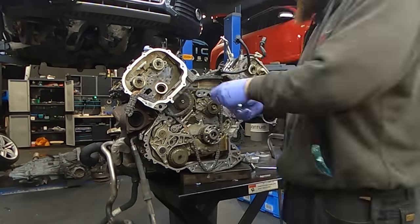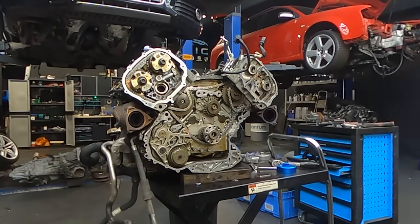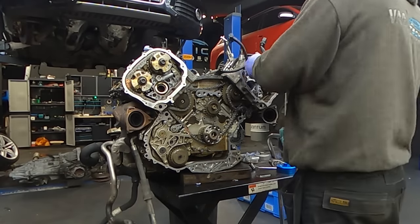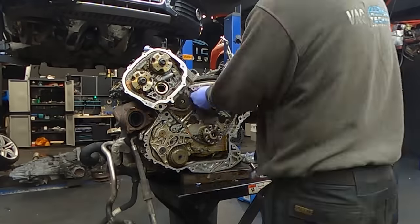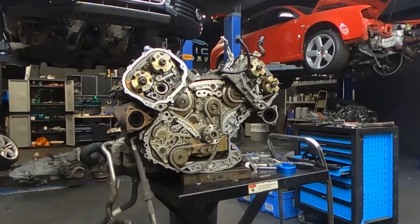We're not tightening the camshaft adjuster bolts before all the tensioners are released and everything is in place. As a last thing, we're going to tighten to the Newton meter spec, and we will do 3 or 4 turns and try to reinstall the timing tools to check if the timing is done correctly.